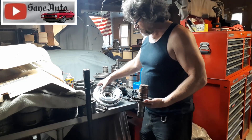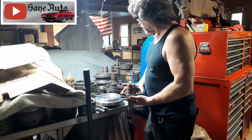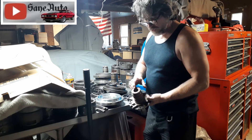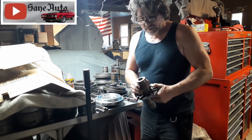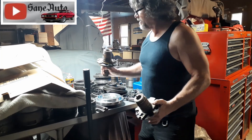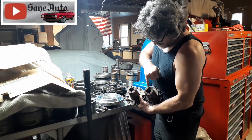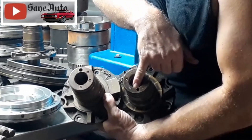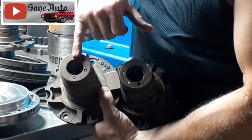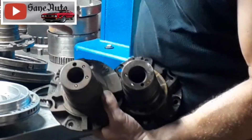The next thing is these stators. There's always a stator bolted to the back of the pump — assuming you know how to take five bolts out. The stator for the 4R70W — you're going to be able to tell the difference between it and the AOD. Right here on the AOD, you have a bushing near the top, and that bushing is not there on the 4R70W, but the bushing that's way down inside is present in both of them.